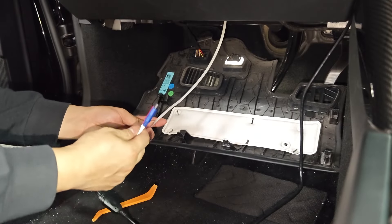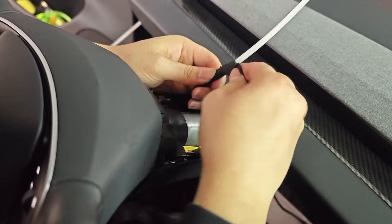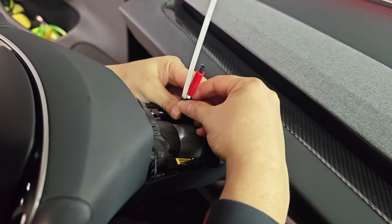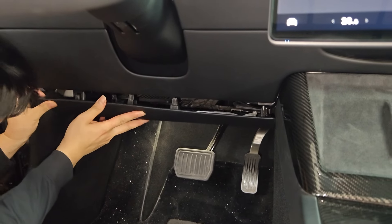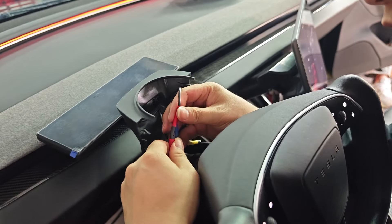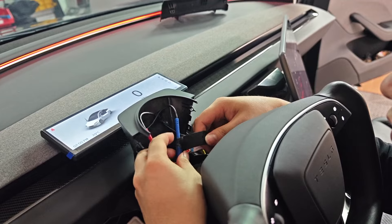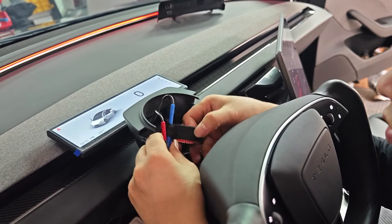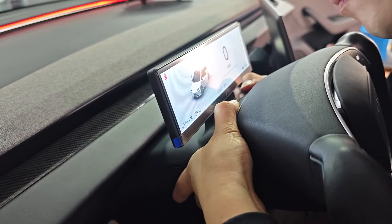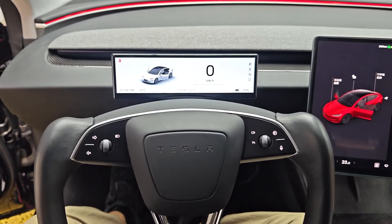Tighten the wire to the fishing line with electrical tape, then pull the cable up underneath the steering wheel and through the steering wheel column. Remove the tape and get ready to install the display and attach it to the steering wheel column. Make sure you close the bottom compartment nicely. Plug in all the wiring — blue to blue, red to red — and the yellow one is for the front forward camera. Clean up and tighten all the wiring together with wiring tape so it's easier to manage and to put back the steering wheel column cover. Put everything back in the same spot. We are done with the installation — it looks really nice and clean.